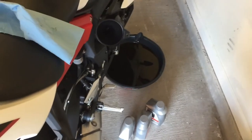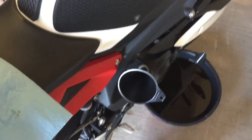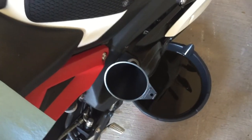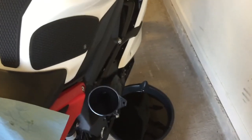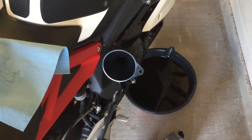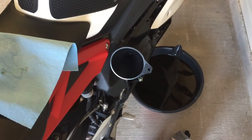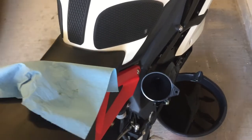When you're filling, of course you need to know how much oil to put in, and use a funnel — don't try to manually pour it in. The funnel just makes it so much easier than trying to delicately guide it into the little hole. Also have a paper towel nearby, because even if everything goes cleanly, when you pull the funnel out the new oil will be running down the spout and dripping on anything underneath, so have a paper towel ready to wipe down the funnel.